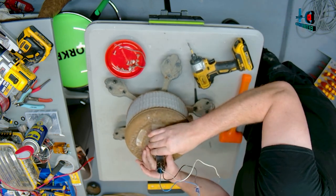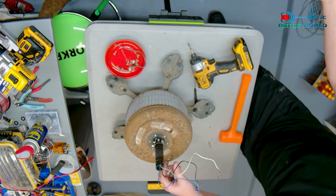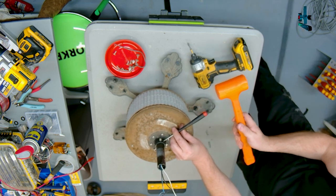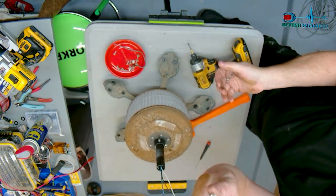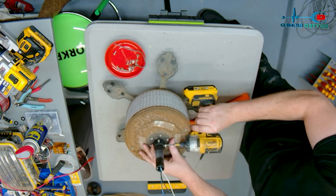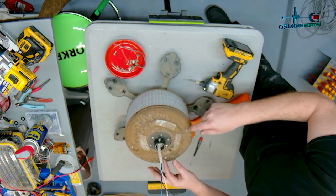Here we go - we've got another series of fasteners. The drop tube is the customizable part. Some are 16 inches long, some are two feet, some could be four feet or more, and others like this one are only six inches long. There is a cotter pin right here - light tap, and I pulled out a literal cotter pin. I'll reinstall that hardware so I don't lose it. Now the drop tube is technically loose and ready to go.